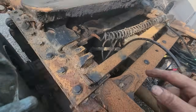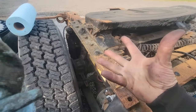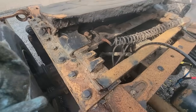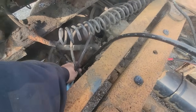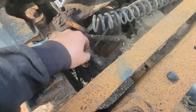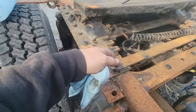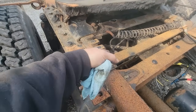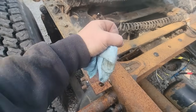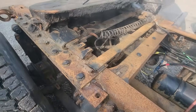So now the parking brakes are engaged because we released air. Now that big hard coil spring is taking over. So we just take this loose and put it back. We push it in and then try and pull it back out. If it stays in, it's locked in right. If it's not locked in, you go to put air to it to overcome the springs, and that line will just fly off and go flying around. So we'll make sure it's in good.